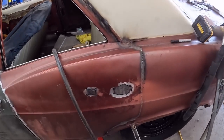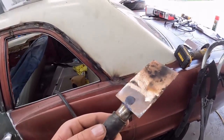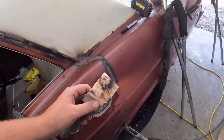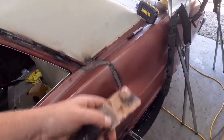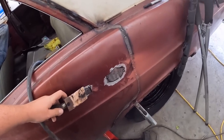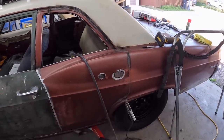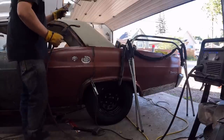And just like that, four ugly tack welds later, we have a door handle there basically. Next thing we use is this little piece of copper, and I'll put it on the back side so the little gaps in between, you can weld right in between there. If you do get any weld on this, it won't stick, and it'll dissipate the heat a little bit and all those things, which let's be honest, we really care about in the bodywork here. Back, weld it, and then we just got that bottom piece to do. We're jamming today.